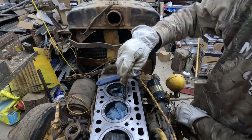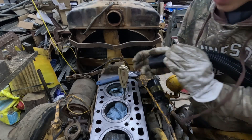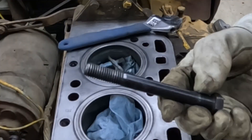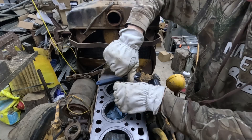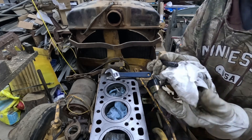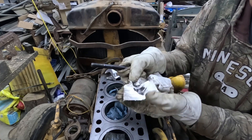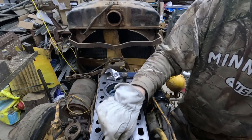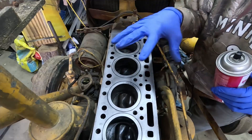You can see it brings up quite a bit of junk. I've been using this little wire brush — run it right down into the bottom of the hole, and as I'm coming up with it I just suck up the dust and debris. Then I have one of the bolts with cleaned threads that I run all the way down and up. If there's any liquid down in there, I've noticed it squishes up, so I run it in and out a couple times to clean it up. As for the cylinders, I put them all level with each other, and we'll wipe the contaminants out of each cylinder before we throw the head gasket on. I'm deeming this surface clean enough.